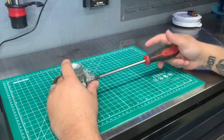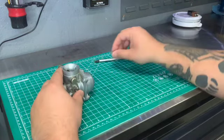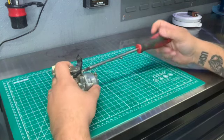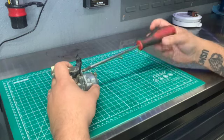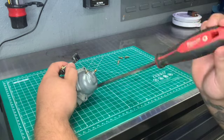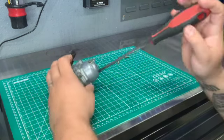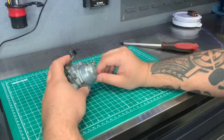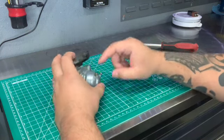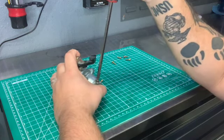This is just a model — this is really clean compared to something that would come out of a bike. This is the original carburetor for the Polaris. Just undo these four screws at the bottom of the carburetor. This is what holds the float bowl to the actual carburetor itself. You could go ahead and remove the drain screw as well at the bottom of the float, since if you're going to be cleaning it, might as well take it out.